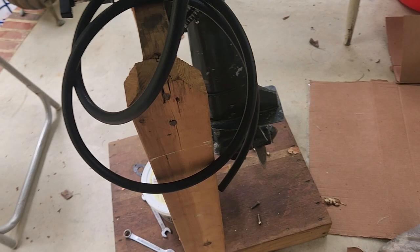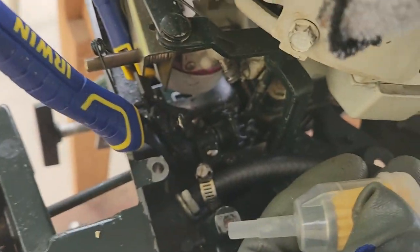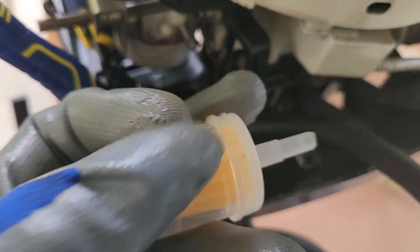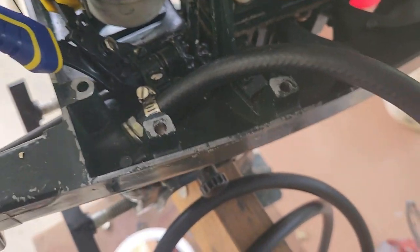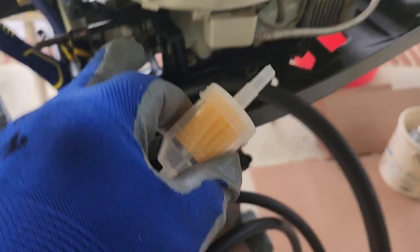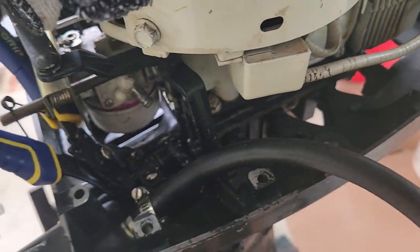All right, we're getting our gas line fuel on. Got a bunch because Amazon makes you buy enough for 20 installs. We've got some little screw clamps that we're putting on. You always point this part away from the carburetor — flow is going that way — but this one doesn't have an arrow on it, so I just confirmed again online it will be going that way. I'm going to screw this one down and then cut the line, figure out how to fit this guy into this space, then run the line back.